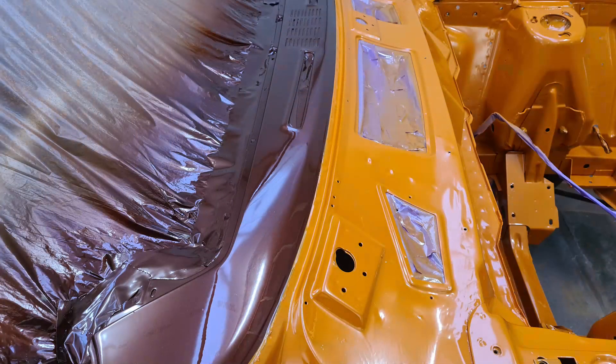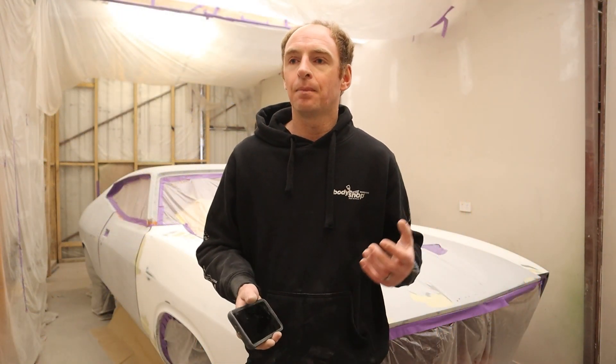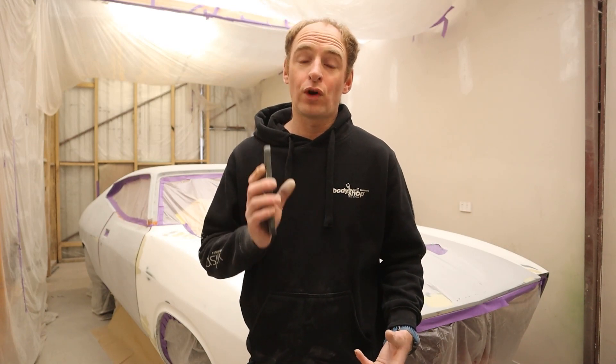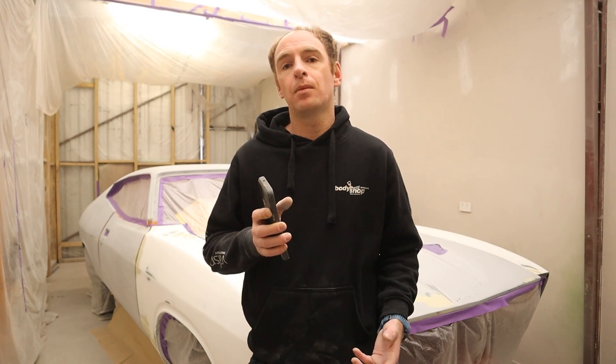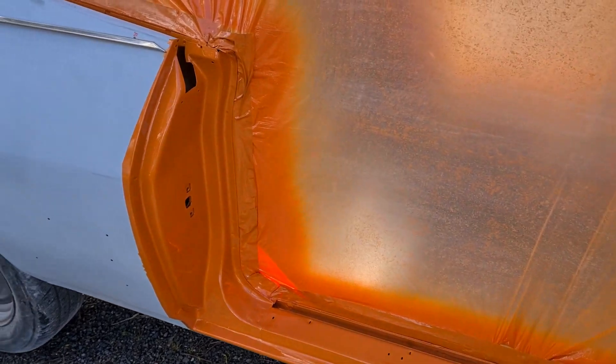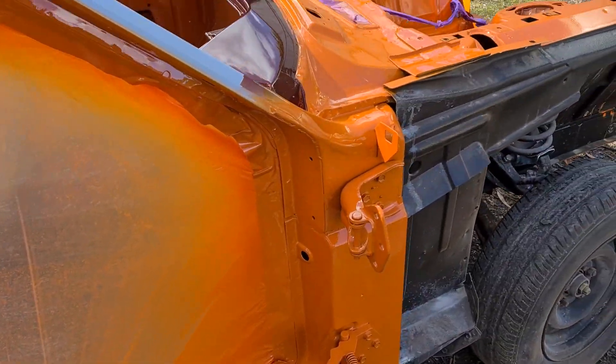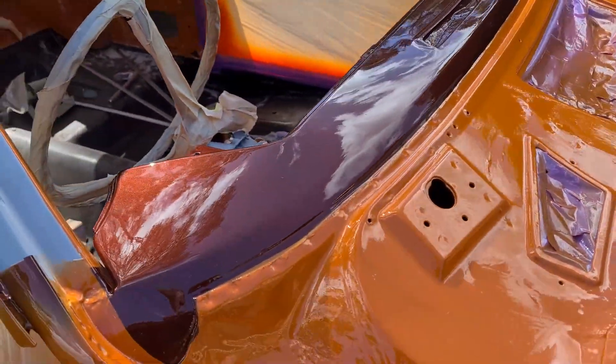In order for the car to last a longer period of time and to be able to drive it on a wet day, having an engine bay that didn't have any seam sealer in it — if I didn't repaint it — it would have rusted out over time from the inside out. So I decided I'd mask up a few things and basically seal the whole engine bay and paint it.